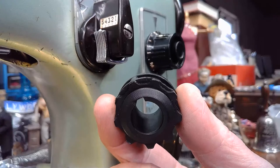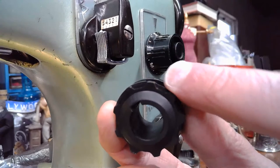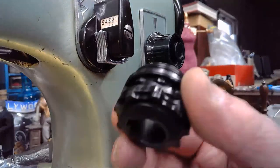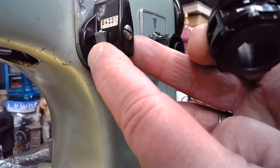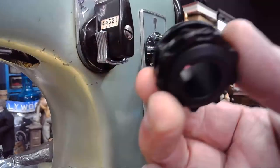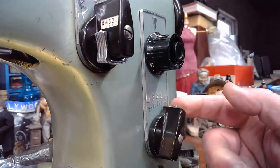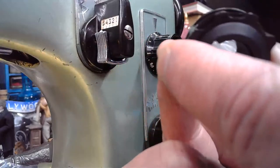And all of a sudden you're going to get gibberish from the machine because that cam finger will not be calibrated to read these bumps properly. So my point is, again, when you're trying to take one of these cams in and out, let's say I don't want B revised anymore. I want to try A revised. So extend this slider all the way to position 5, which we know is our zigzag, but it also extends that cam stack all the way to the rear. And then you have to bring a little lever down, pull the cam out. And you always do that with it on 0 so that that finger, again, is retracted. Hopefully that makes sense.